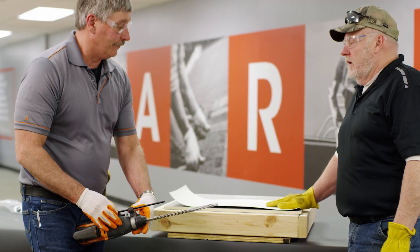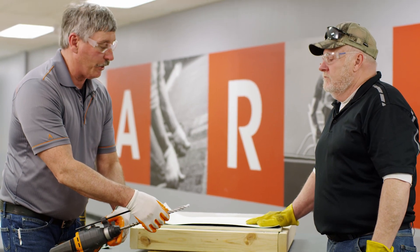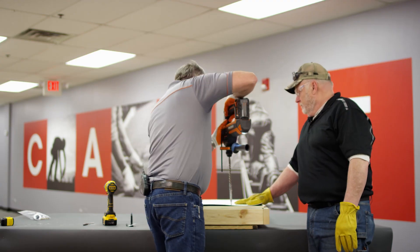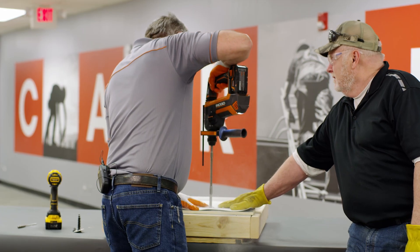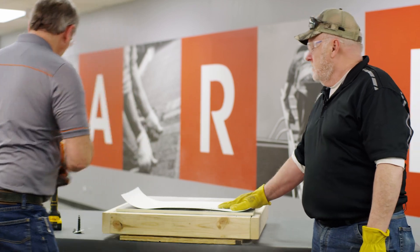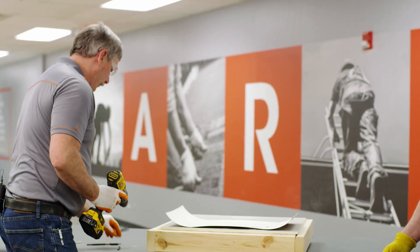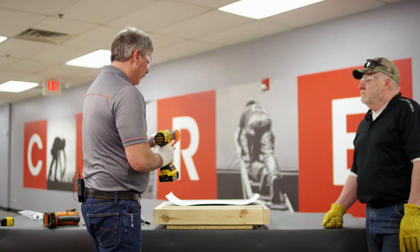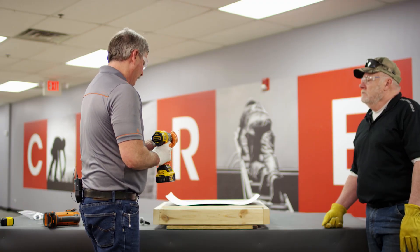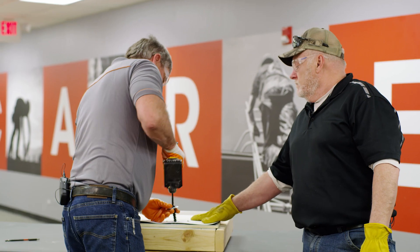Now this bit is a little long — obviously this is not going to do us any good. So I kind of cheated, put a little piece of duct tape on here so I know how deep to go. That makes sense. Nicely done. Notice the dirt. Again, I've got to change my bit out, put in the square drive. This is where guys have got to be real careful with those impacts if they're using one, because that's a plastic fastener. It's really easy to strip out.